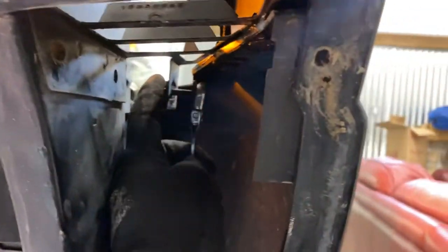Slot, slide back in there, and you can get that from right here. I had the fender well out because I was doing a plug change, checking the brakes out. As the fender is out, you can actually pull a few push pins down here, pull it back. You get a 10 mil ratcheting wrench up in there, just loosen it up.